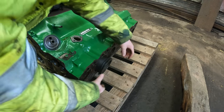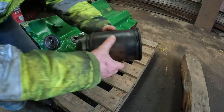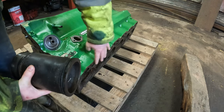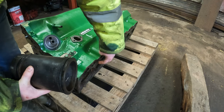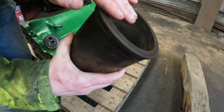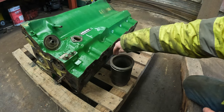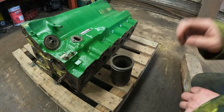Just like that. This one's got a shim on it as well - the first one had a shim on too, as you can see. Just this tiny little shim, because when we put the new ones in we've got to have a dial test indicator and measure the stick-out because they sit proud. I'll look in the book and tell you.